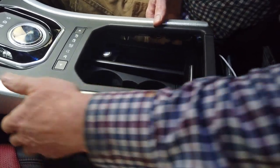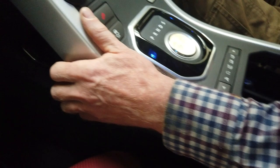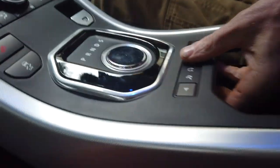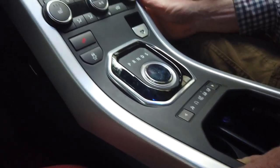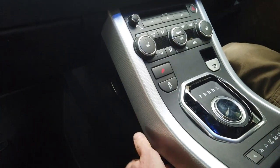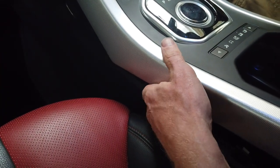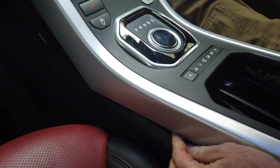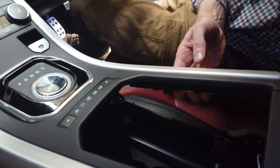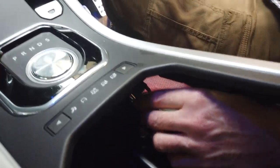There you go. If we have a look under there, George, you should see some connectors under here that are limiting my travel. Let me see how much. The other thing worth knowing is that I think you get a handbrake error once you disconnect it, but it will clear after a few cycles. So what you've got to do is press that little bit on the side of the connector there. It should release that connector. And then I've got the same deal on this side. Let me just grab a camera up and show you.